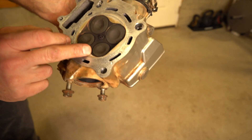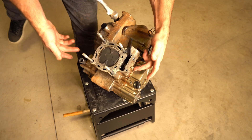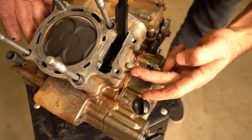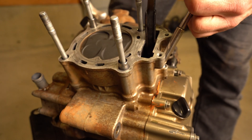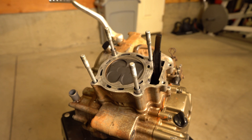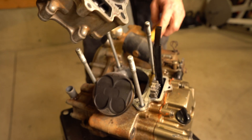I don't see anything major on this, but we won't know until we take those valves out and see how the seats are. Now I'm going to take this bolt here — there's just that one — and then we're going to pop the bore out. I do want you to notice these guides in here. It looks like two of them stayed with the head and there's two on here, so just don't forget about those. I thought I was going to have to take a hammer to this — but no, look at that, it's going to come right off easy. So here's your bore.